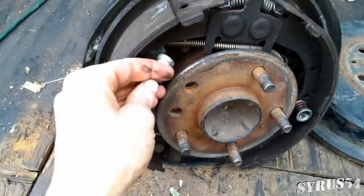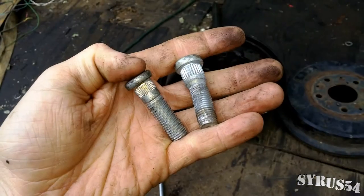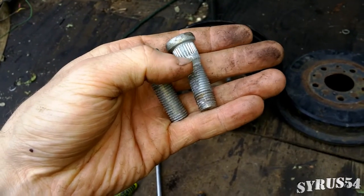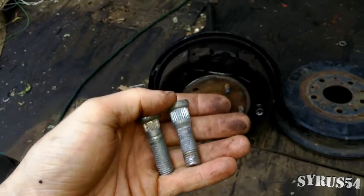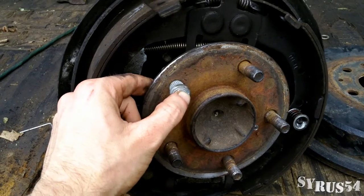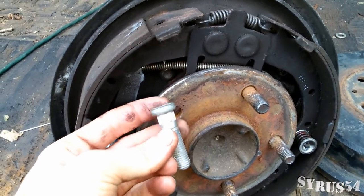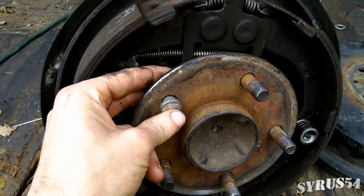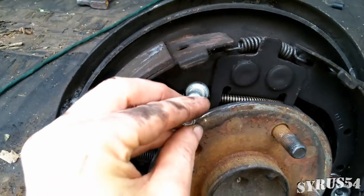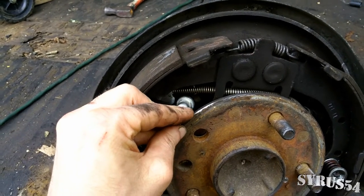Spin the rotor around so you've got some room in there. Another thing to take into consideration: there are different sizes of these, so you want to make sure you get the proper size. If you don't get one that has a big enough rim around here, it's not going to seat into this drum. Make sure you get the one that is properly sized for your rotor. If you get one that goes all the way in and bounces around, it will come out on you — it'll get caught up in all the braking stuff back here, and when you're going 90 miles an hour down the highway, this is going to pop out and it's like slamming on the e-brake. Your rear axle is going to lock up and you're going to go spinning out of control.